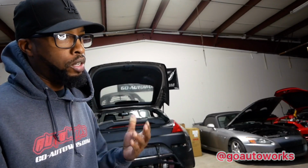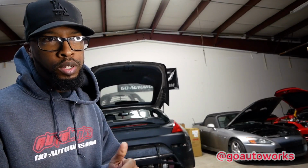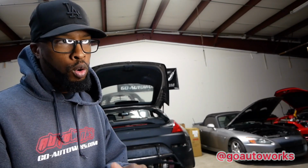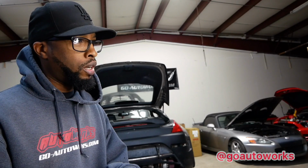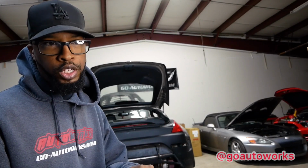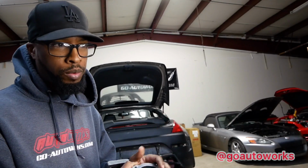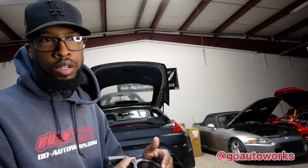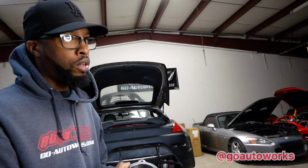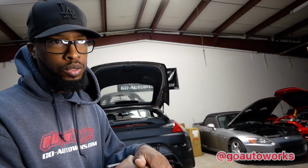That's why I can't really put it on anything, because I don't typically make a downpipe for any of our kits to use this flange. I actually have an order for one right now where I'll use this housing to bolt up just to get this flange placement. But again, it's a spacing thing. There's nothing wrong with the housing. It works on some apps, like rear wheel drive, because the turbo is typically pointed back towards the back of the car. But in front wheel drive apps, it just takes up more space than I like to use.